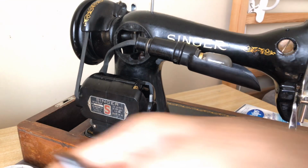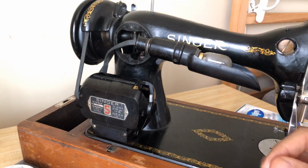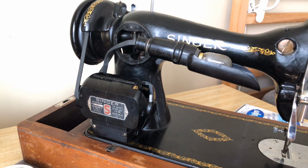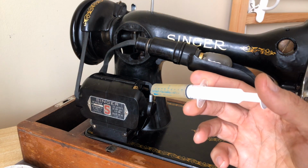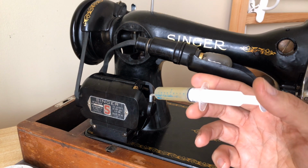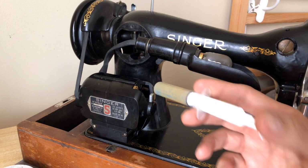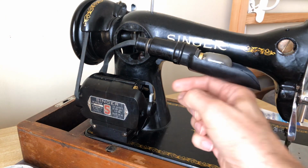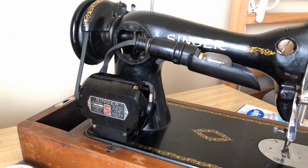She's good to go. Now, one last thing. You think, well, does it have enough grease in it? Because this thing is really small, guys. It doesn't hold that much. So I'm going to do what I call topping off. Now, if you do this with an old wick, you can do it, but you don't know how well the old wick is going to allow lubrication to flow because it's got a lot of old dried up stuff. Now, you'll notice it looks like I just put frosting on top of something there.